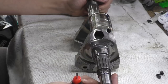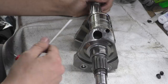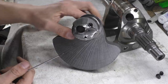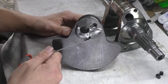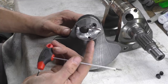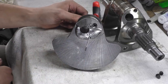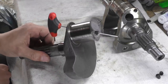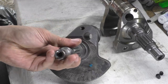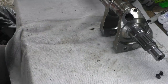These are different cranks. These are manufactured in different ways. They have different flywheel, crank web masses, stuff like that. But you can see the cross drilling here. You can see on this one where that hole comes through and how close we are. This is a slight radius, this section, so we're very close to the edge. And if we poke this through here, you can see that's where our cross drilling goes and comes through the other side, like so. And again, this has a similar, not the same, but a similar arrangement with this lightening of the crank pin.